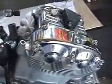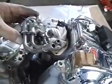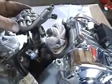The Schrader valve will always be to the right side of the engine where your water pump and thermostat housing are. So make sure that you have the fuel lines going to the back, so when you put it back in, the injectors will go into the right cylinder and you won't have a problem.